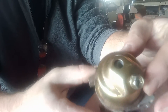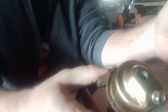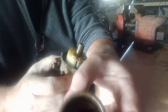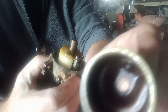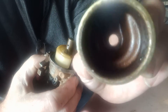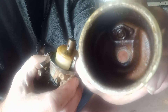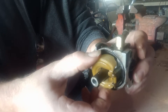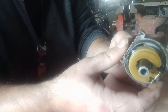This is part two on the Craftsman Tiller Carburetor. They're pulled apart. There's what the bowl looks like — it's been nasty, definitely needs to be cleaned. The float is stuck, it won't even open, so definitely not getting any gas.